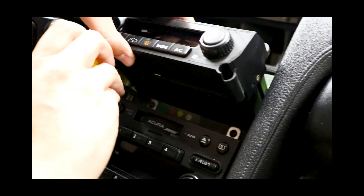Now it's time to remove the radio. You want to pull but don't yank because there are connectors in the back. Go ahead and remove the main connector, then you've got a couple of antenna connectors to take off. On my vehicle I also had the CD player connector, and we're going to remove that one as well. And here it is — radio is removed.